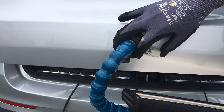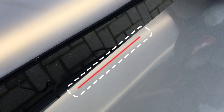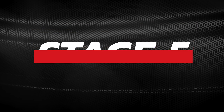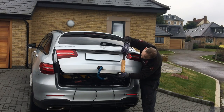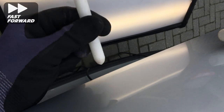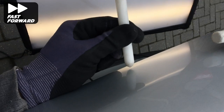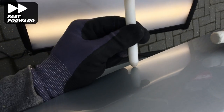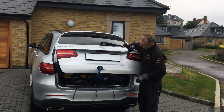It's time now to tackle one of the trickiest parts of this repair: trying to get the protruding frame edge, shown here in red, to lie down flat again. To do this I'm working across this protrusion using my sharp Delrin tap down. It's important to be very accurate with this tool because of the force needed - if I come off the line even slightly I risk putting a very sharp low spot in the panel which I may not be able to remove. Luckily I kept on target and the edge has flattened down nicely.